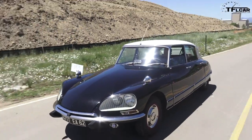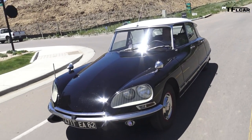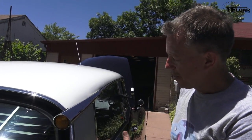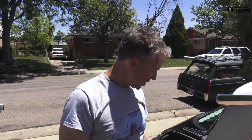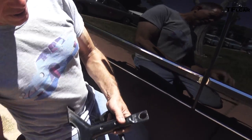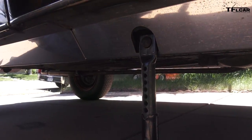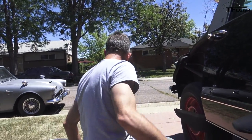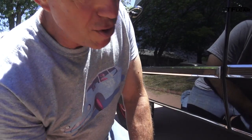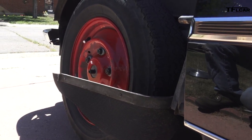To be fair, the three wheels you should drive on are the driver's side rear and both fronts — both fronts, because it's front-wheel drive, you won't go anywhere with only one wheel there. And of course, keeping your missing wheel away from the driver just helps with your weight bias. After loosening all the lug nuts while the car is good and solid, you can take your adjustable stand and it hooks under a peg on the frame. You run the car up to its full height. That same hubcap removal tool now slides into one of these holes. Make sure that stays, and now we lower the car and it will pick up both wheels on this side — most importantly, the one we want to change.